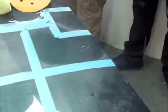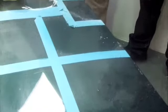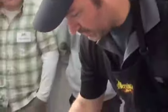Yeah, I wouldn't work on a clear coat paint finish with a wet and dry disc anything less than the 2000. Because we tried with the 1000s when we did the Fiesta, and it took ages to get the marks out. It was too aggressive in the clear coat. I will do a dry disc at 1500 in a minute, but that's for different reasons.